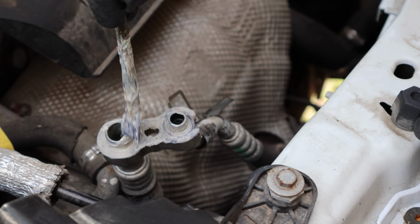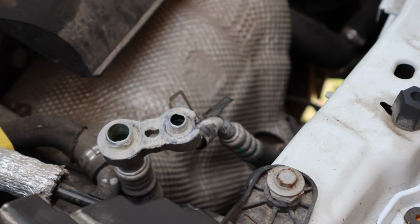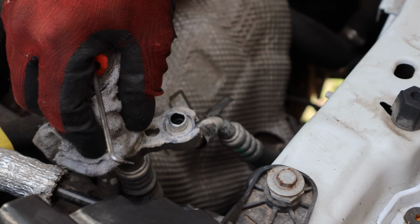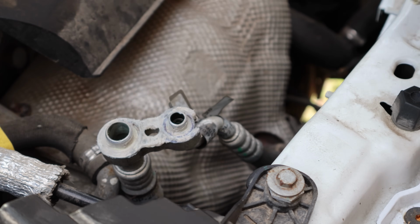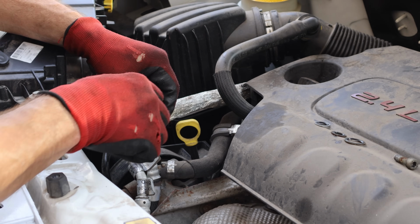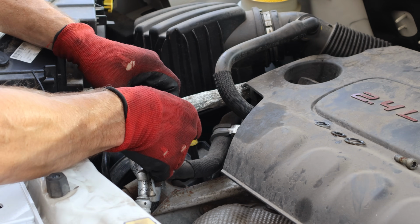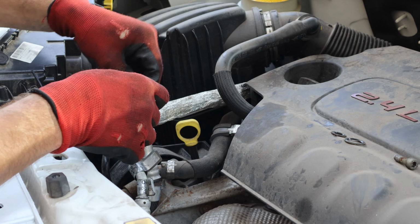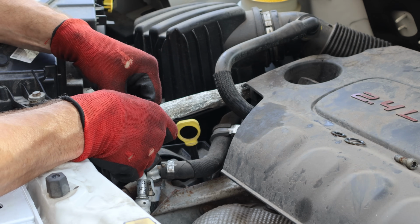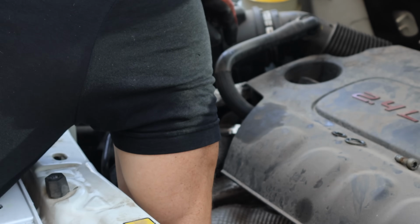Alright, Picasso. It's good. Get that last little bit of grease out of there so it doesn't end up in our compressor. Not that I think it would hurt it, but it's not supposed to be in there. Slip our sealing washers over there. And yes, there's the old ones and the new ones right next to it, because I know we have trust issues, and I have been accused of not putting new ones on before.